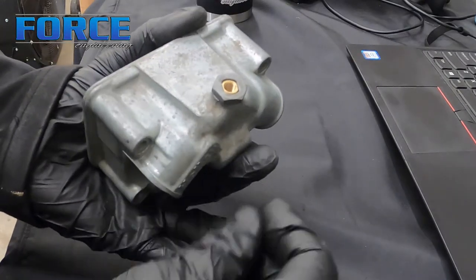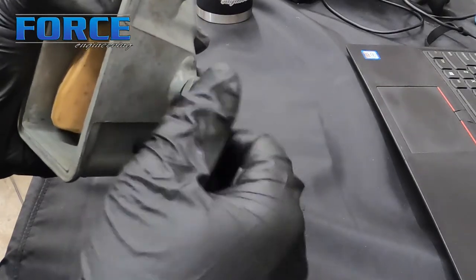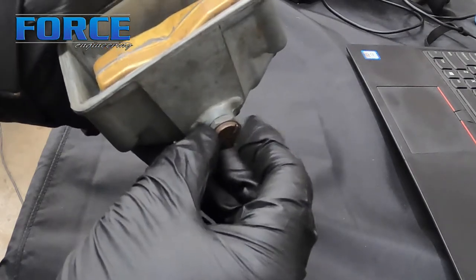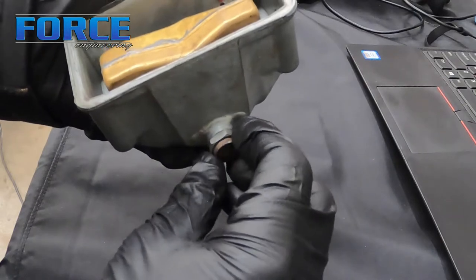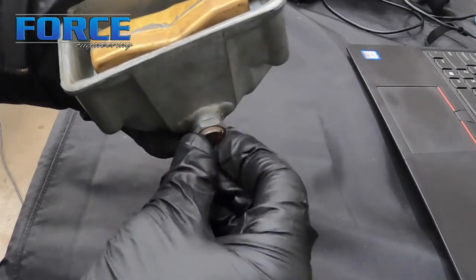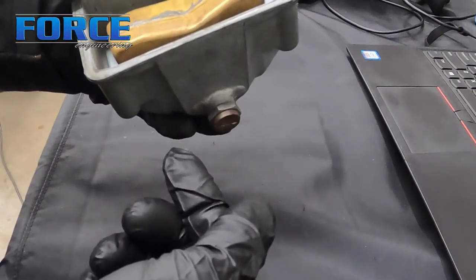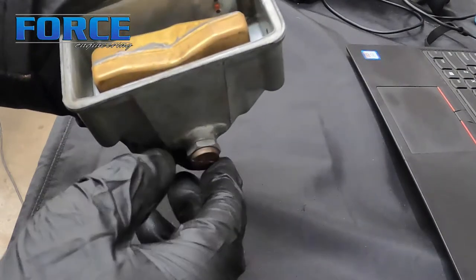The adjustment is all in the hex nut — the screw on top is just the jam. So if you need to raise the float level, you break the jam loose and move the 5/8 nut a quarter turn, then tighten the jam again. If you're lowering the float level, you back the jam screw off about a half turn, then tighten the hex. They're different thread pitches, so don't run the jam all the way down. Move it a quarter turn and tighten it back down. When lowering the float level, loosen the jam a little further than you would if you're raising it. Then just move it where you want, tighten it with the jam, and recheck your float level.